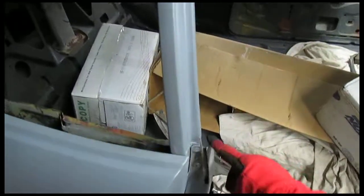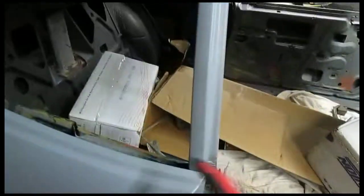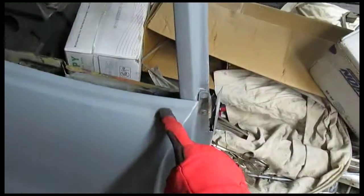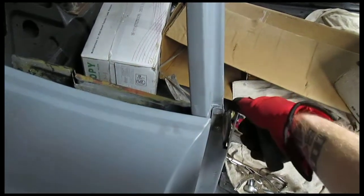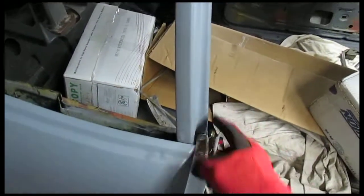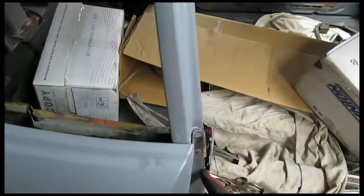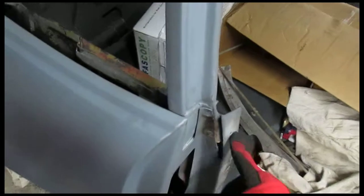This is interesting. This actually came all the way out, and when I swapped the panel, the original first panel I got, which was off a 70 Le Mans, also stuck the whole way out here. I guess it's something to do with the post cars not having the same door frame, so I just cut this and wedged it back, but once everything else is welded in, I'll be able to figure it out, cut it, weld it in properly, and make it all fit nice.